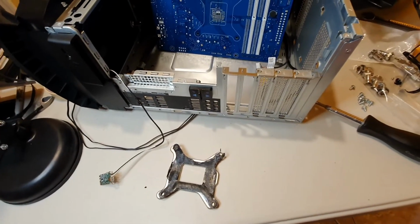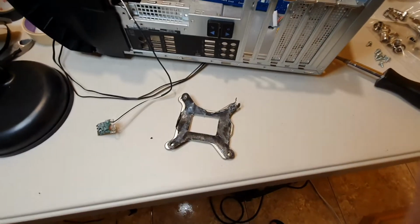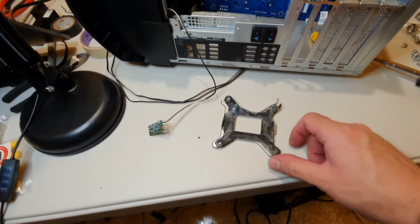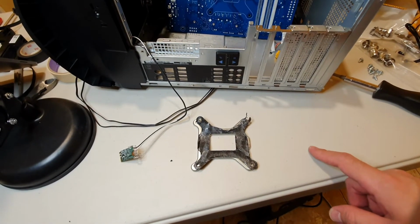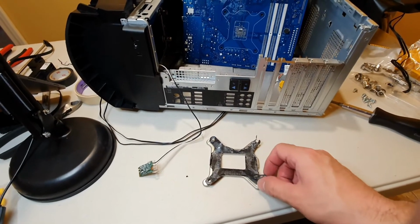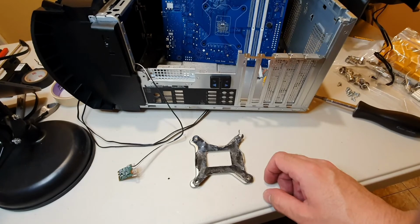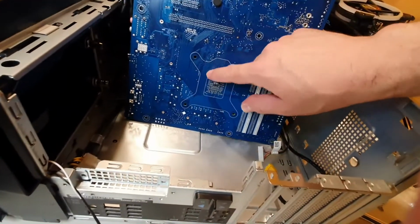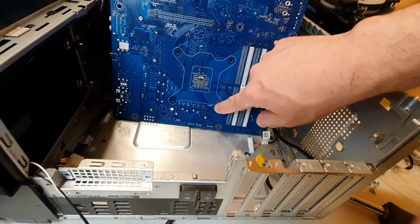The reason is because the backplate for the CPU cooler uses non-standard size screws, and the ones on my EK water block won't fit. So I had to remove it, which was really hard because it's glued on. But you can heat the glue up with a heat gun a bit, and then just clean off the residue with some alcohol.